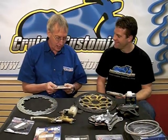So Mark, here in my hand I have a GG rated pad and you've got an HH rated pad in your hand. What do those letter designations tell us about these brake pads? My pad stops better than yours, Kyle. It's a higher friction rating. HH was the next generation after the GG standard.